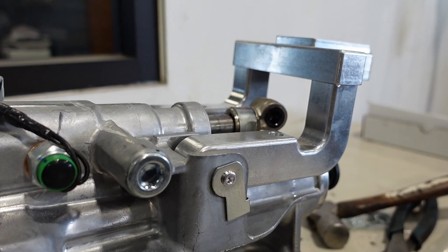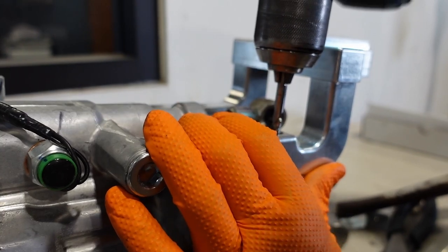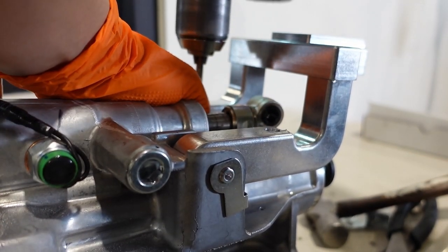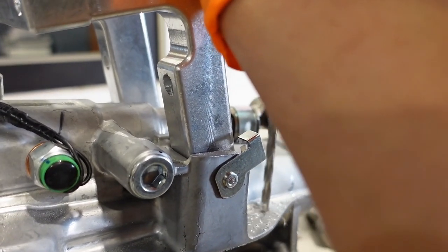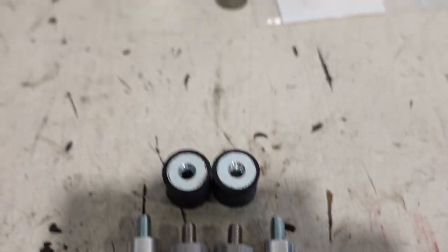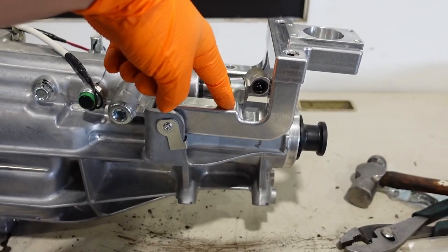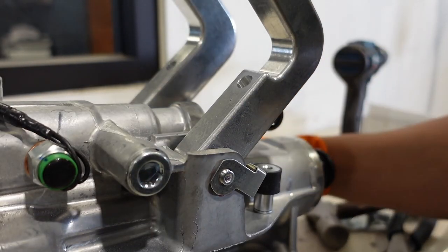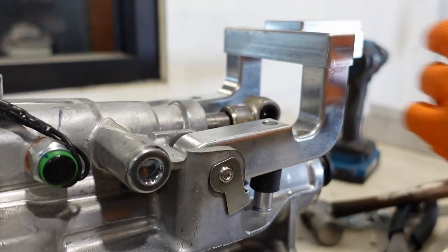We need to drill a couple of holes with a quarter-inch drill bit, using the shifter base bracket as a drill guide. Get the shifter base bracket as level as possible and keep the drill as straight and upright as possible. Use the shifter bracket to get a pilot hole started, then rotate the shifter base out of the way and drill those holes all the way through the aluminum case. You'll have a selection of spacers — smaller ones for the OEM TL70 shifter, taller ones for the Torque Solutions short-throw shifter — as the fulcrum point hangs lower and could contact the driveshaft without proper spacing. Coat all bolts with red Loctite to keep them from backing out.